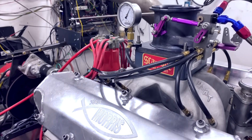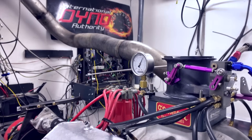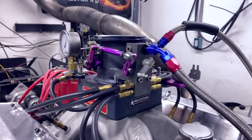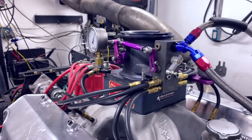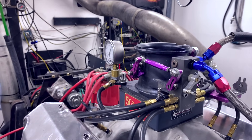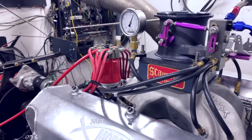The Ron's toilet-style fuel injection system is not actually like electronic fuel injection — these are just nozzles. The pressure gauge provides the fuel to be dispersed into the engine; it just comes through a nozzle, so there's nothing electronically stopping it — it just pumps in all the time. In stark contrast, your modern vehicle has a pintle valve that spurts fuel as necessary, not just constantly draining fuel because there's pressure there.